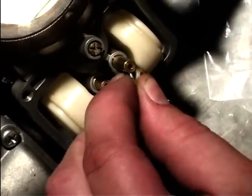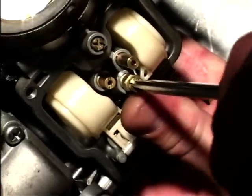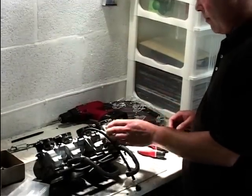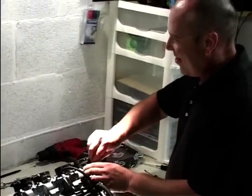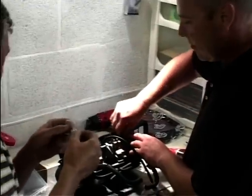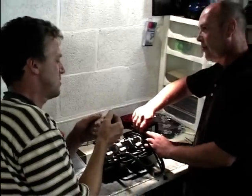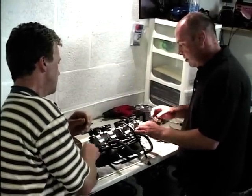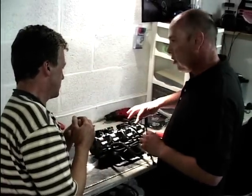This all looks very straightforward. It is so easy — there's nothing difficult about it at all. Make sure that's tight, nip that up. Ready to put the float chamber back on? Not just are the jets in this kit, but there are needles, there are springs and little circlips and things. That all goes in the other side — those are on the vacuum sliders.